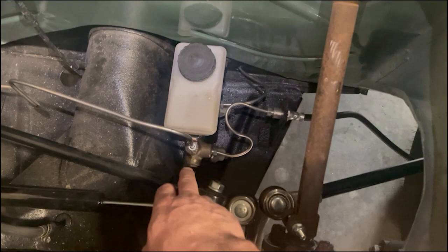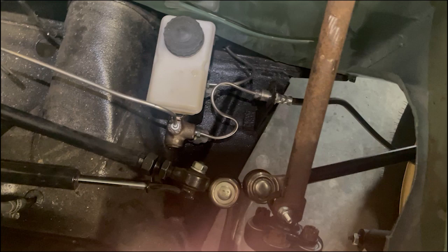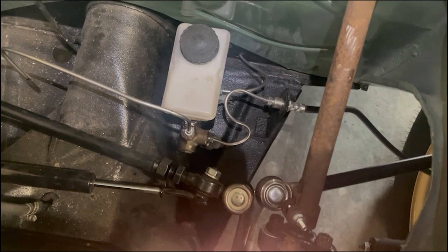I don't have a gas tank in — I have a small reservoir here while I'm finishing up the work. As you can see, here are the tie rods heading to the passenger side and the driver's side. You would loosen these nuts here and twist these to adjust the toe-in or toe-out. In my case, it's a toe-in. But the issue is which one do you adjust?